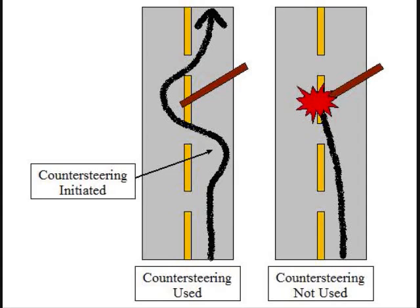And that's going to dip the bike to the left, which is going to lean the bike to the left and allow you to turn very quickly. And then the same principle would apply when you want to swerve back to the right. You'd actually push on the right hand grip and it's going to turn the wheel slightly to the left, which is going to cause the bike to dip and lean to the right, and then you're going to be back on your correct path.